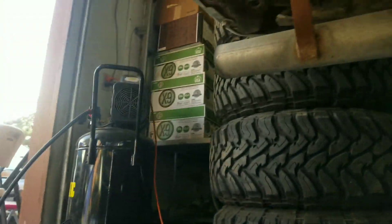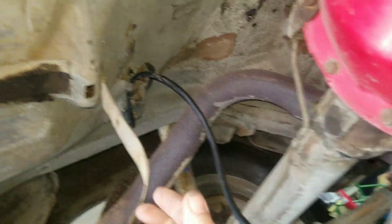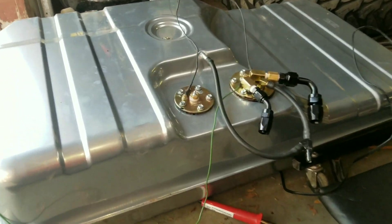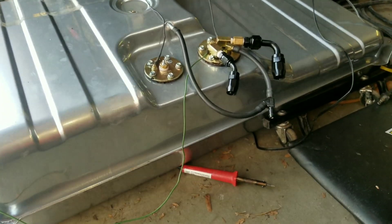It attaches - I made this bracket right up there. So I actually have my rollover vent right up there, right next to my frame, so it's high enough. I've got the tube running down here and I have not cut it to length yet because I don't know how long I need it. I put a tie-down right here so it shouldn't go anywhere. Now what I'm gonna do is take my tank and put it up there. I've got the fittings angled down - they are tight and secured - so that my fuel lines are gonna come out and down to the passenger side.